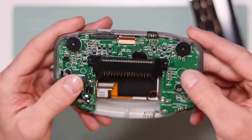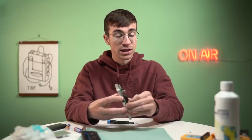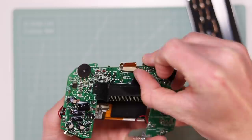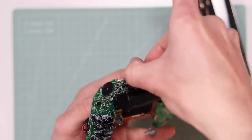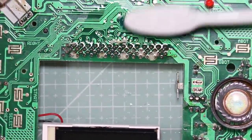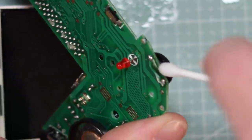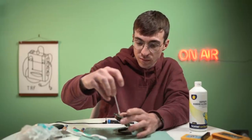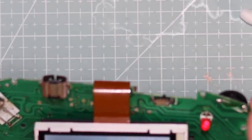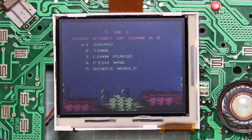Not as high quality as the original Game Boy, but I've certainly seen a lot worse. And although this thing isn't that old, it is still very impressive that they managed to condense that entire console into this one device. So let's remove the screen — that's just done with this little latch here. The backlight, interestingly, is separately connected to the motherboard, so we'll have to be really careful with that. Toothbrush, isopropyl alcohol, and a little bit of scrubbing. It works! It bloody works!